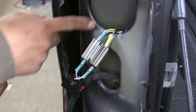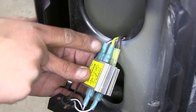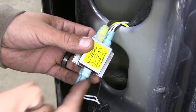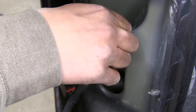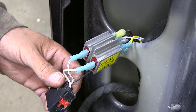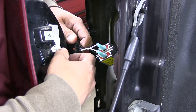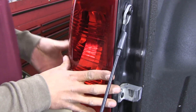Before we put our taillight back in it is always good to double-check your circuits — I noticed that we have our circuits switched. The white wire with the blue stripe should have the brown wire attached to it, and the plain white wire should have the yellow wire attached to it. We'll double-check that the other end of each diode has the matching wire, which they do. So we just need to switch our taillight wire and our turn signal wire into the correct diode. Now we can put our taillights back in place, plug our harness back in making sure it locks fully into position, push the red tab back in so it locks the taillight in, line everything up, and re-secure it with the hardware.